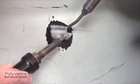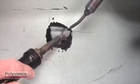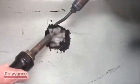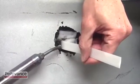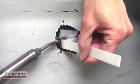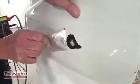While the weld is still hot, smooth it using the airless and nitrogen plastic welders simultaneously. Add more layers of plastic to increase the thickness as you see necessary. Once the weld on the backside cools, remove the aluminum tape.